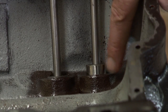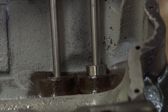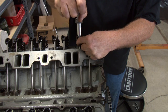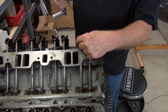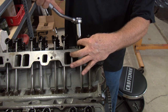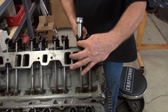Now you can see that I've rotated the engine and this lifter is pushed up — that would be your exhaust valve. It's just going down, so keep it where it's going down. We're going to back this off half a turn — that's where I had it adjusted — so you can spin it nice and easy with your fingers. Now we're going to tighten it until you feel it get tight. There's tight. And then we're going to give it a half a turn, like that.